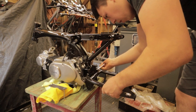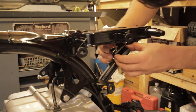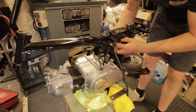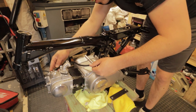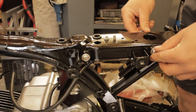Following that I go for the swing arm and put a new swing arm bolt in. If anyone watched the first videos, I found this bolt was actually bent where it had taken an impact at some point — so brand new bolt there and it all looks straight. We can then move forward to some electrical parts: the HT lead, the spark plug cap, and the coil bolted on. They sit right in the middle of the bike so it's a no-brainer to get that on early.